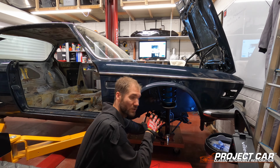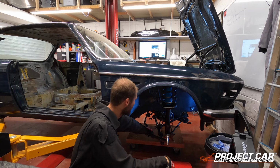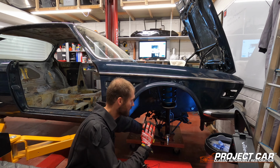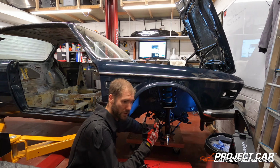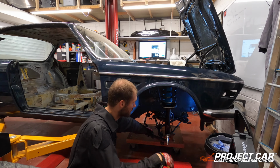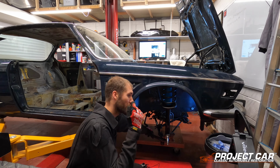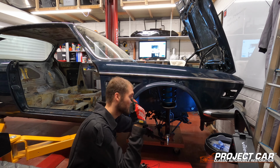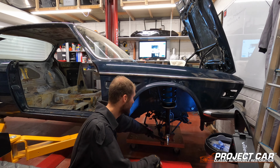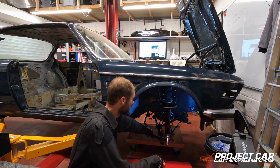Make sure that there's nothing attached to the bodywork. We need to double check that the engine is completely separated from the chassis. So I'll go and do that now. I'll make a look around, make sure there's no hoses connected to anything, no pipe work, no steering assembly, nothing like that. Everything has to be loose in order for it to drop out, or we might get stuck somewhere and start breaking parts. So I'll repeat the same process on the left hand side. After that, I'm going to make a good look around, and once that's done, we'll get the cart underneath it in position, and we'll get ready to drop it down.